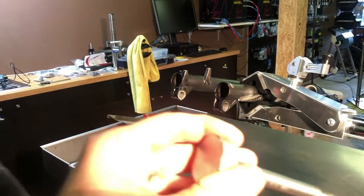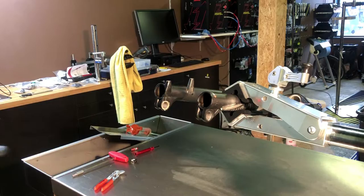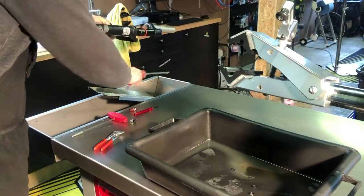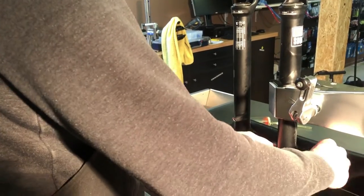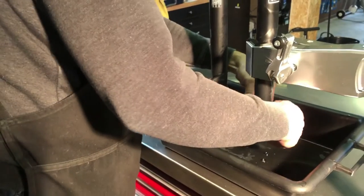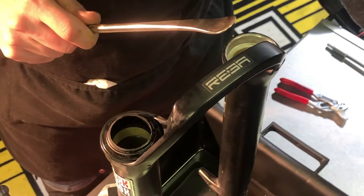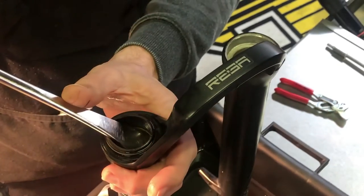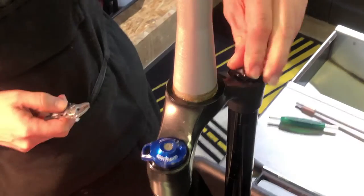We use specific damper and spring-side removal tools to prevent the threads from being damaged. With the removal tool in place, give it a solid tap with a mallet — this should be enough to break it loose. With the lower legs loosened, you can rotate the fork to a standing position and remove the damper and air spring. Be sure to have your oil drain pan ready because oil will be coming out of the fork legs. Because only the fork brace keeps the loose lower leg in place, it's good practice to strengthen it using a through axle. We're going to replace the foam rings, seals, and sag ring, so we need to remove the old ones first. Using a long tire lever, we can pop the seals and foam rings right out. For now, we're going to leave the fork legs for a while and focus on the damper and air spring.